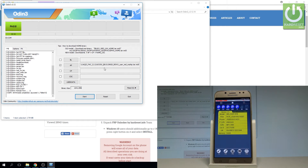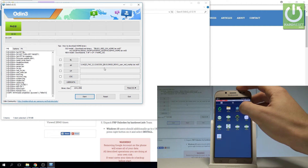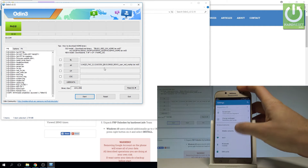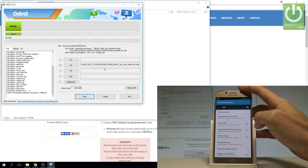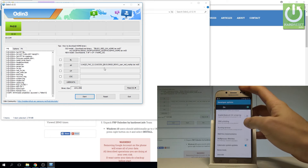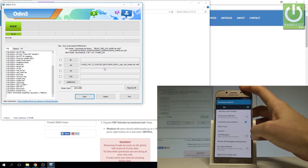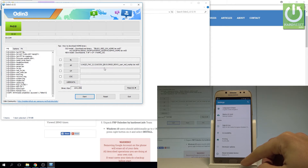Now this is the developer mode that you can use when you load your combination firmware. Here you can choose the apps icon in the corner — from the menu let's choose Settings, scroll down to the bottom of the list, choose Developer Options, and make sure that you have USB debugging switched on. As you can see, my USB debugging is activated.